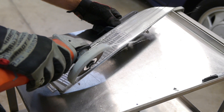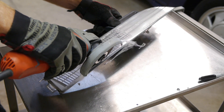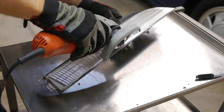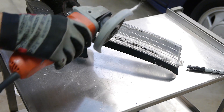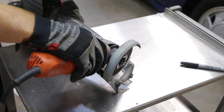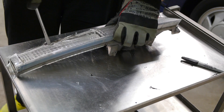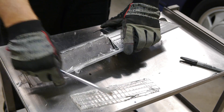Just take your time here and you should be able to make some fairly straight cuts. Although this process wasn't great, so if anybody has any ideas on how to cut straight lines in a plastic lens like this, post them up in the comments — I'd love to hear them, I may be doing this again in the future. The vertical cuts are a little trickier and a smaller wheel will help keep you from going too far. Once those are all done, just grab a screwdriver and pop out the lens.